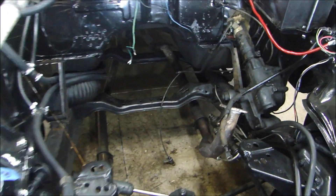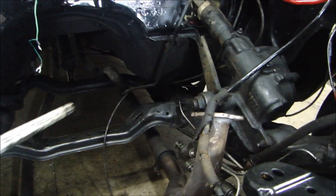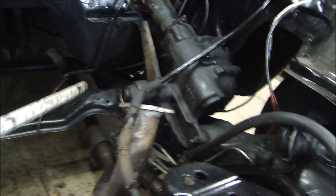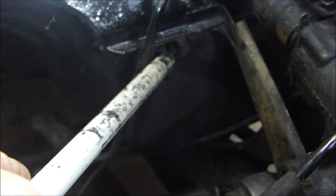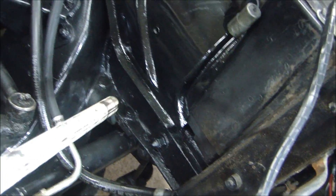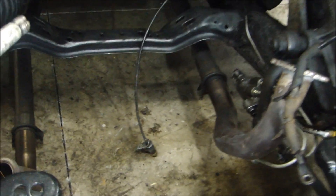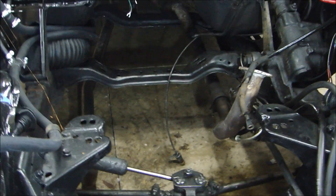I'll be bringing the engine in on an angle and I have to get it down inside there. The first thing will be to get it hooked up to the transmission yoke in the back — I've got to slide the transmission yoke inside the rear of the transmission. Then I have to hook up the gear shifter, which goes into the transmission. We have the cable there for the speedometer. The accelerator pedal linkage has to go in this hole right here. You have to be careful for that. It also makes it easier to hook up the wire for the starter that comes from the starter relay. Coming around the front, I have to think about the power steering hoses and the fuel line. Then eventually getting to the exhaust — one exhaust on one side, the exhaust on the other side — hooking those up, resting the transmission in the holes in the back, and ultimately resting the engine on the front. So let me get it up in the air and start to guide it in there.